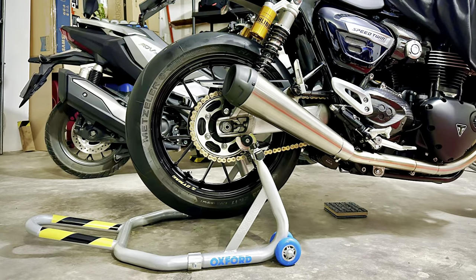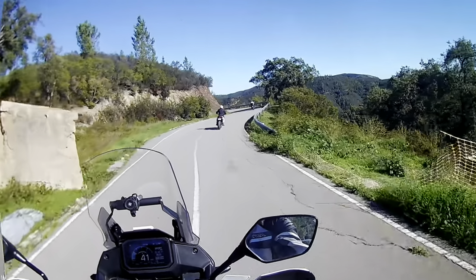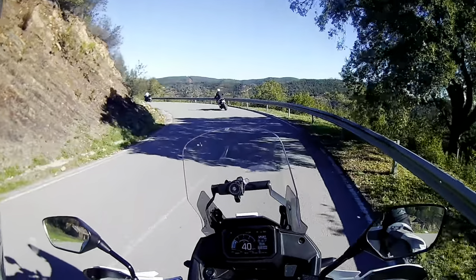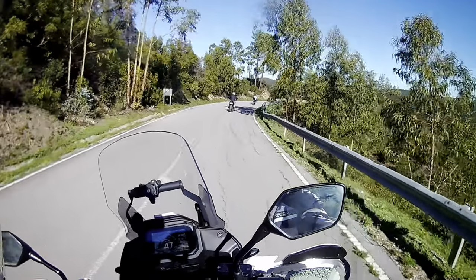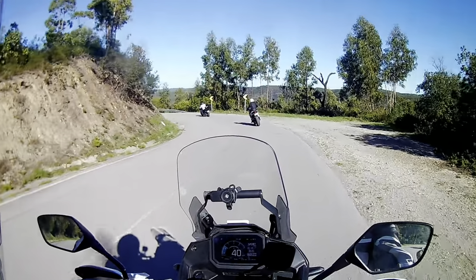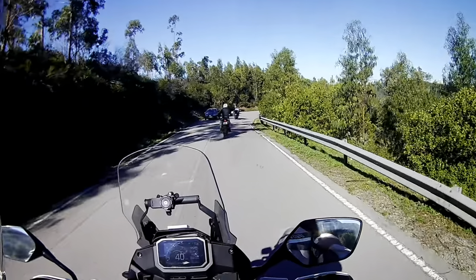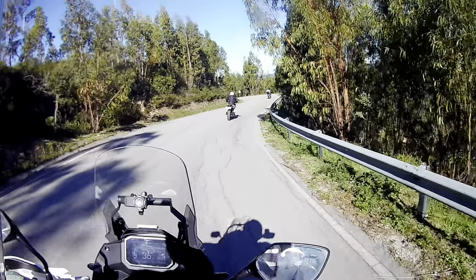With my Speed Twin, I use a paddock stand to lift the rear wheel off the ground, but it's too small for the Transalp and the tyre doesn't clear the floor. Buying a high-lift stand was one option, but they're just as expensive as centre stands and it would have meant one more cumbersome piece of equipment cluttering up the garage. A centre stand adds about 3 kilos to the bike, but it is very low-down weight, and I just thought the added convenience of having a mobile paddock stand was worth it.